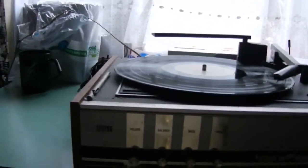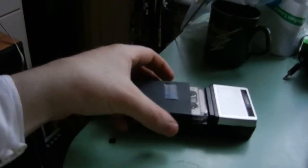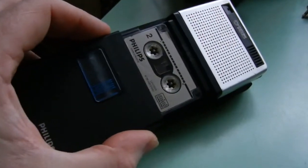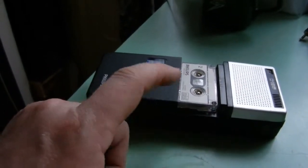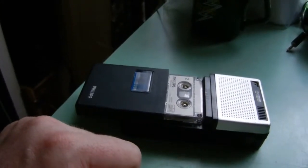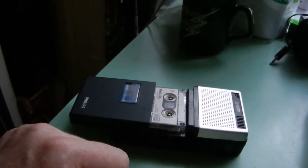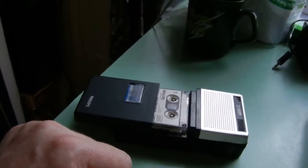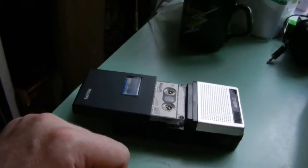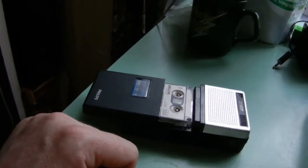Another thing I found up there was one of probably the very first mini cassettes. This little item, I bet it doesn't go, but it's even got a Philips tape in it. These were very crude. Unlike the Japanese-made micro cassette, these mini cassettes were rim drive, and you all know how inefficient that is, really. You won't get a steady tape speed, and the recording made on your machine would be okay-ish, providing it was speech, but might sound like Mickey Mouse on someone else's. And what's the betting it's full of rotten belts? Still, for only 50p, you can't really argue, can you?